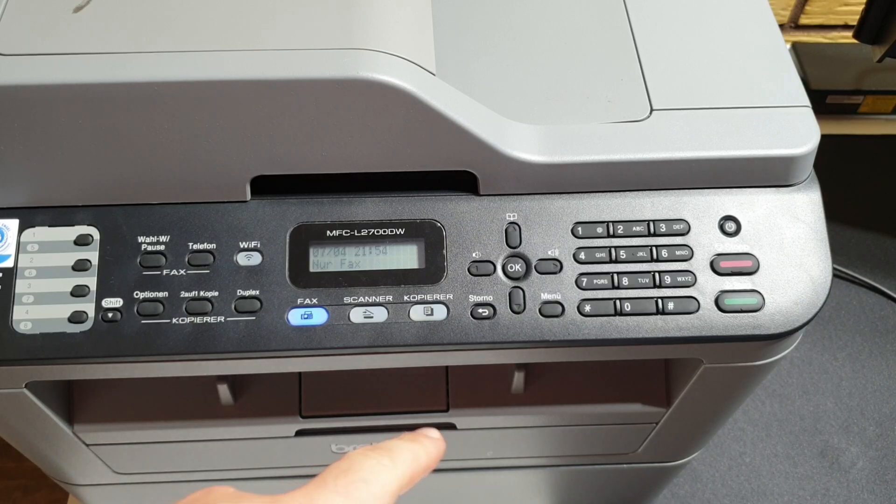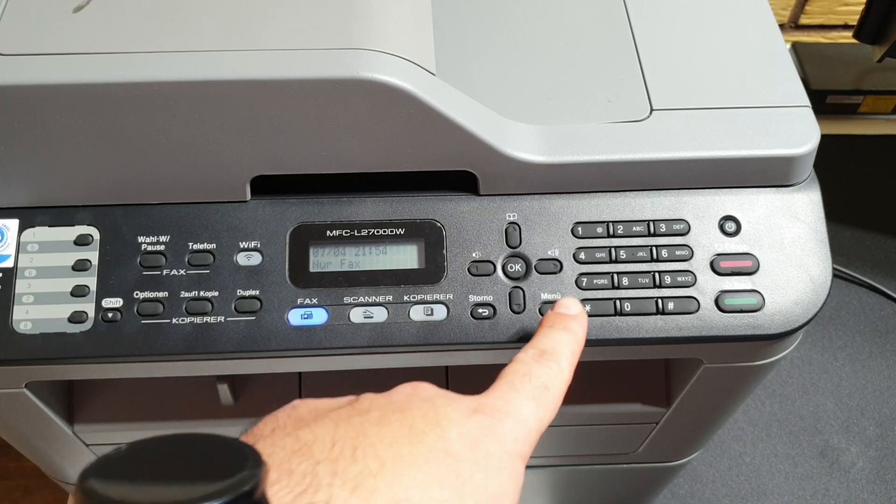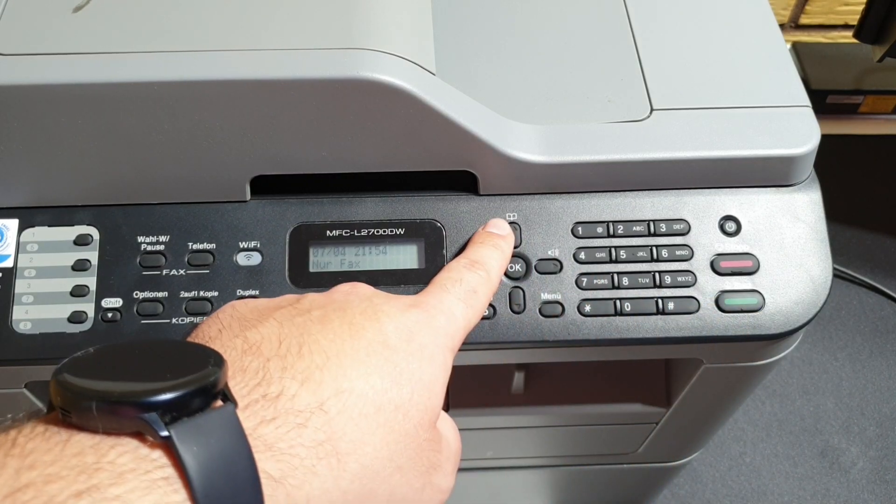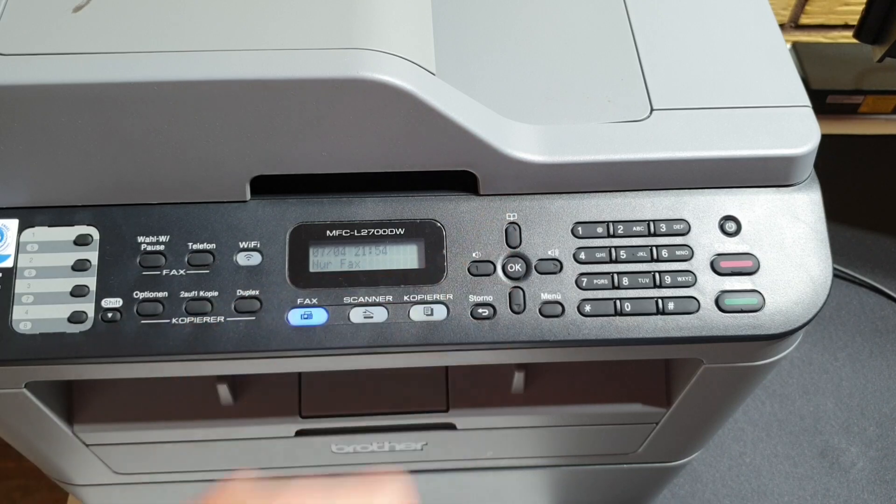It's very simple — I hope this will help you, so let's get started. First, what we need to do is put the printer in maintenance mode. In order to do that, we should press the menu button, start button, and up arrow button four times, all within two seconds, in order to put the printer in maintenance mode.